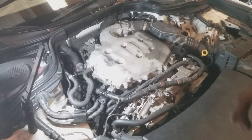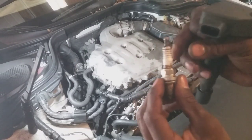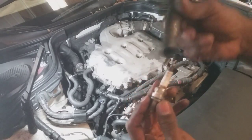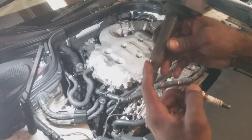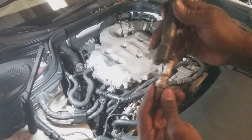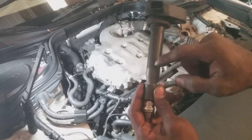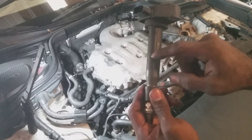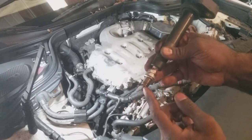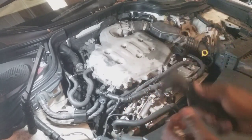That's the portion. Let me see. All right, make sure the porcelain. So the porcelain is going to be here. This has to be insulated. So once the spark gets emitted from the secondary side through here, down through the top of the spark plug into the cylinder, if anything from here on down isn't insulated, such as this insulator here for the coil, that spark or arc, and that fire that's supposed to be concentrated from the electrode to the ground, is not going to have an efficient burn, hence why you're going to get the misfire.